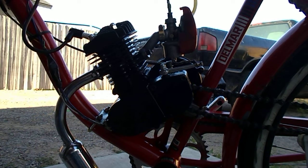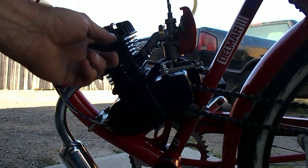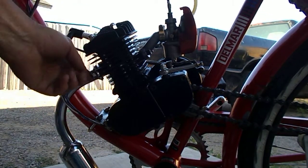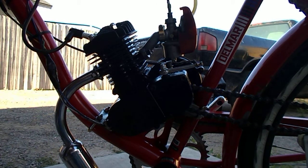I'm not saying this is the perfect motor for every application, but for a motorized bicycle motor they work pretty good. The thing about it is that when it fires at the top and the piston is being pushed down, the scavenging effect from the exhaust has a tendency to suck some of the air-fuel mixture in through the port, and that's why you can end up with some oil dripping or smoking too much.